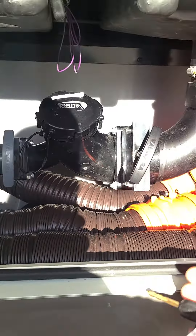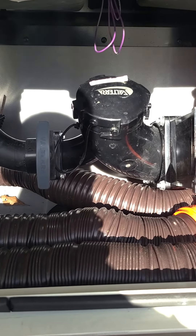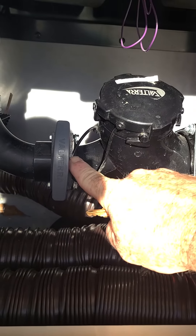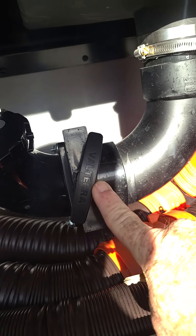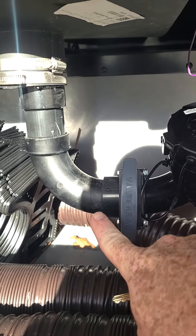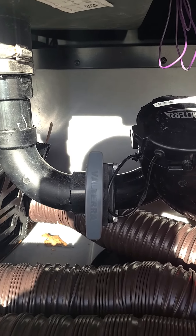You will already have your slinky hose hooked up into the sewer on the campsite. On the left here you can see a gray handle, on the right a black handle. You can also tell the difference — the bigger pipe is gonna be for your black tank because there's gonna be solids, and the smaller pipe is gonna be for your gray tank because it's all liquid.